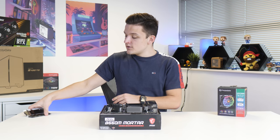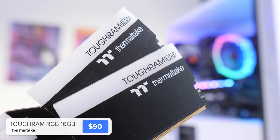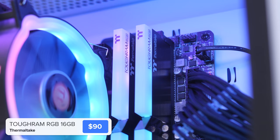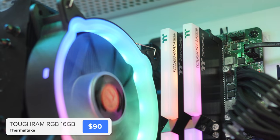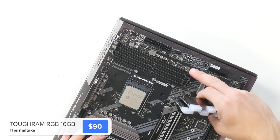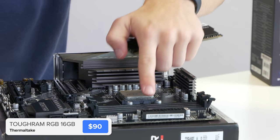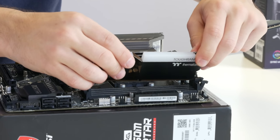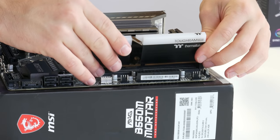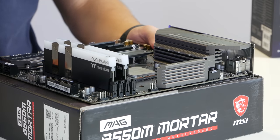It's a great opportunity to install our RAM or memory. This is a 16 gigabyte kit of Thermaltake's Tough RAM. It's got a 3600 megahertz clock speed and some of the best widespread motherboard compatibility that I've seen on RAM in quite some time. To install it we're going to head over to our RAM DIMM slots and pull back the second and fourth clips. It's then a case of lining the notch on the memory with the corresponding notch on the motherboard and sliding the RAM nicely into place. It's going to clip in on each corner.